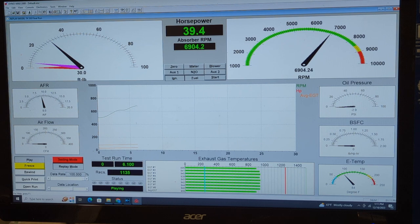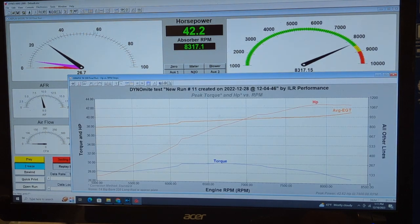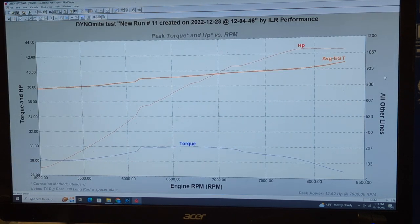The first hang you actually feel when you ride it — that's when the bike comes on the power band and you feel the hit. The second one you never actually feel, but you'll see it in the graph. You can see the power valve opens actually kind of late on this motor. It was a very low mileage motor, so the power valve opens later because there's not a lot of wear on the spring. Springs get softer with time and the power valve opens earlier. This one actually opened about where it's supposed to for a brand new spring. The second spot is where the horsepower really goes flat, but the motor starts to take off, the dyno tries to catch it, adjusts out, and then runs on over the top.